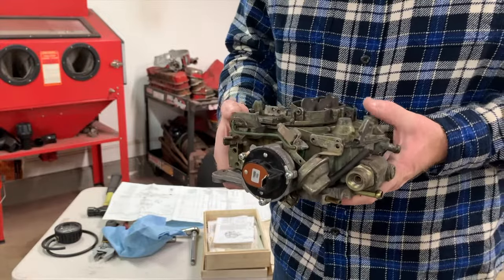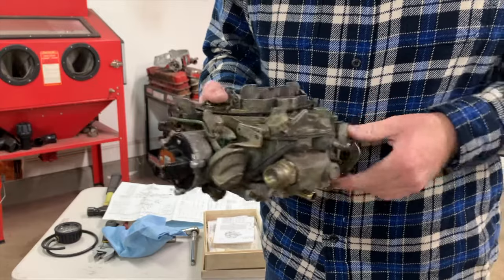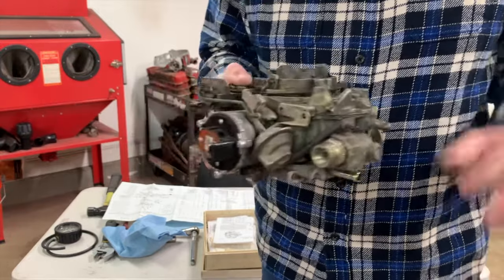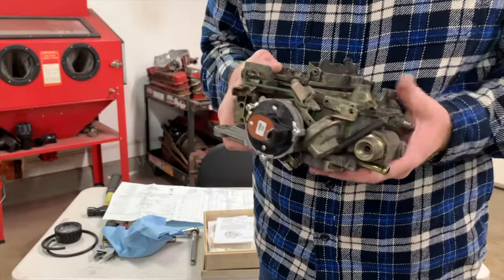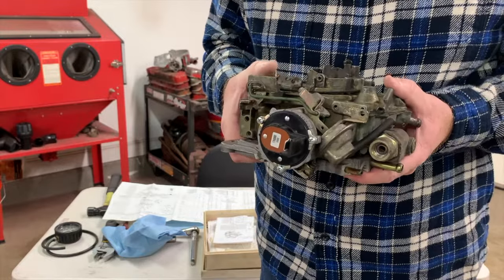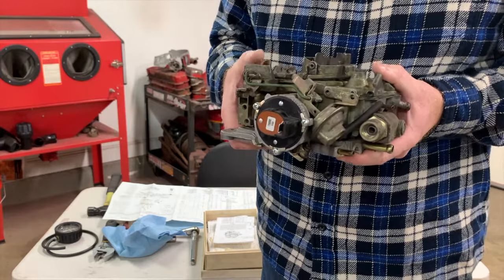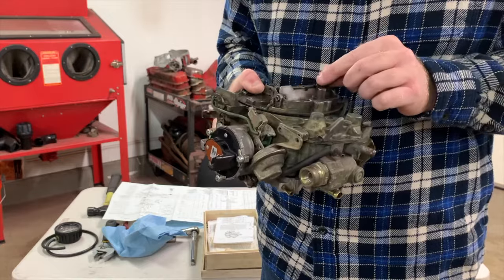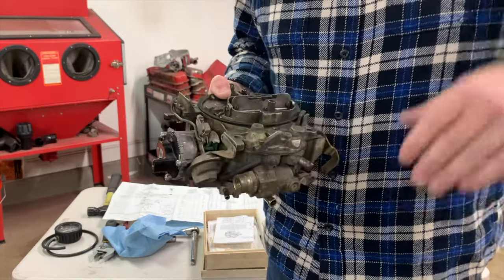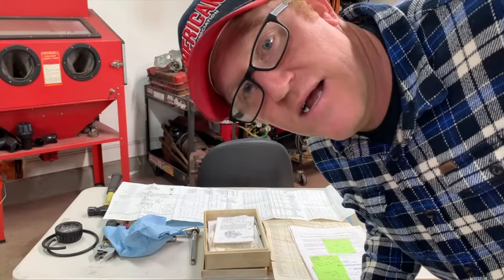So that's when the engine's up to operating temperature generally. So it works as you go down the road. That's why a carbureted car, if you press the throttle one time, start it up, it'll go up to 1100 RPM. You go inside and let it run for 10, 15 minutes. You come out, it's going 1500 RPM. Well, that's because now the engine's up at operating temperature. It doesn't need as much fuel as what the choke is delivering. So the engine speed goes up. So now we're gonna practically apply it.